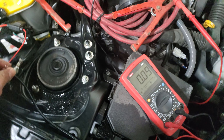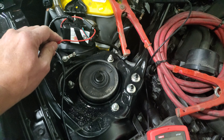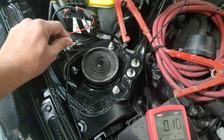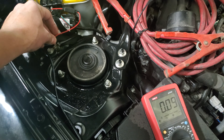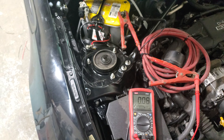As you can see, with a wide view — as soon as we plug it in, the amps jump; as soon as we remove it, they drop. This is a case we see a lot when people do DIY installations and run wires incorrectly. The first thing you always want to do is identify what the last thing installed was, and check whether it was installed correctly or incorrectly.